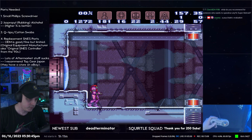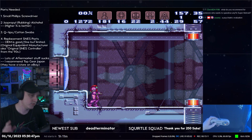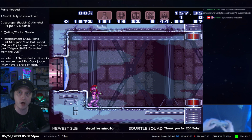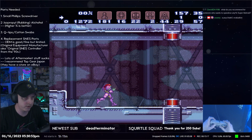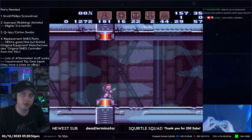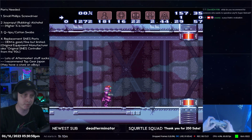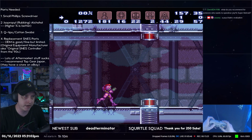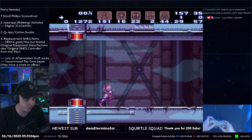Okay. So keeping that in mind, one of the things that I do to test a D-pad and whether it's good or not is I'll stutter, right? So if you look at the top left of the screen, I'm pushing right repeatedly, right? And only right is registering. Right. Okay.